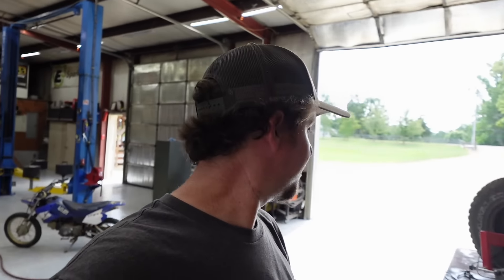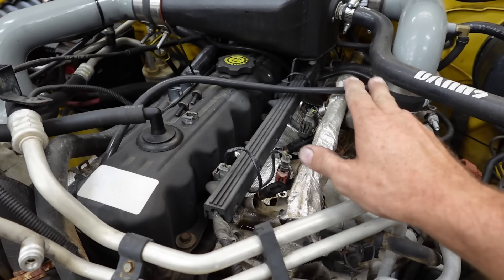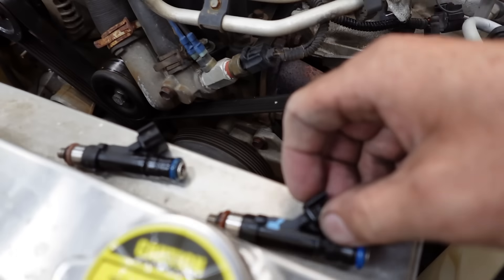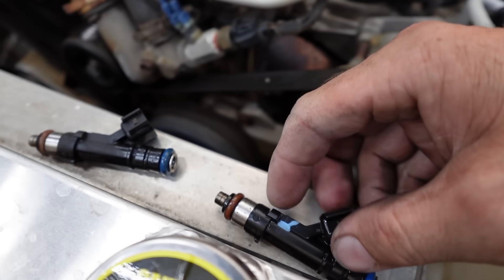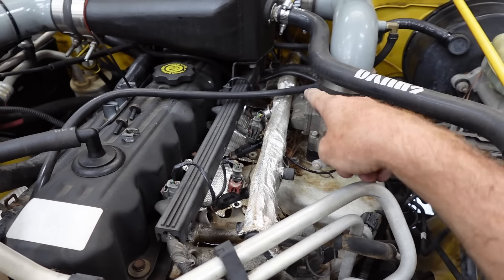I don't have a set of turbo injectors laying around — they've got to be bigger. I'll get those swapped around and see if we can move the miss to another cylinder or figure out why it's calling number four. Got it back in the shop about a week later. I pulled the fuel rail — I've got this injector marked as number four and I've got number one. I'll pull them all out with an ohmmeter and measure them while I'm here; otherwise I'll just put it back together and see what happens.